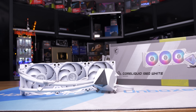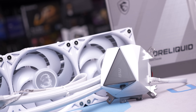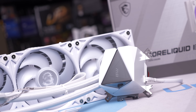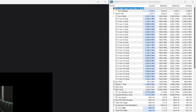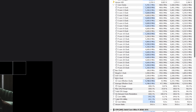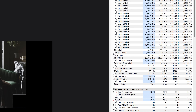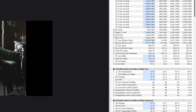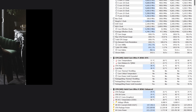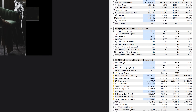Let's look at how the 285K behaves under load. I'm using the MSI Mag Core Liquid i360, which was provided in our review kit and is designed specifically for Arrow Lake CPUs, featuring a unique bracket that migrates the cold plate north for a three-degree reduction in temperature. With it strapped on and loading up the 285K with Cinebench, I saw an average clock frequency of 4.6GHz for the E-cores and 5.3GHz for the P-cores, within the stock 250-watt power limit. Peak core temperature was 84 degrees — well below the 105-degree TJ Max.